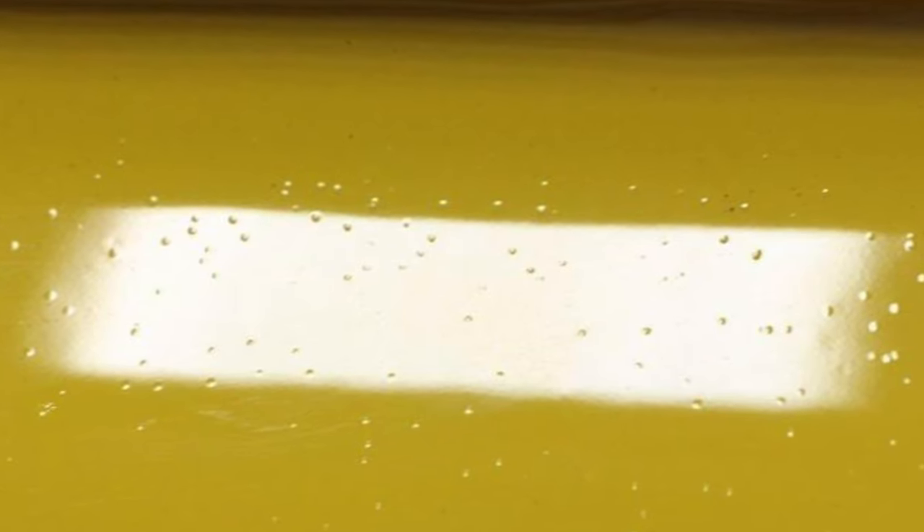However, if you are using a conventional spray gun without thinner, the paint could dry matte, have an orange peel effect or a very uneven finish. If you put too much thinner into a paint mix it can also cause problems — solvent can get trapped in the layers of paint, causing solvent popping. And if the paint becomes too thin, you get runs and sags in the finish.